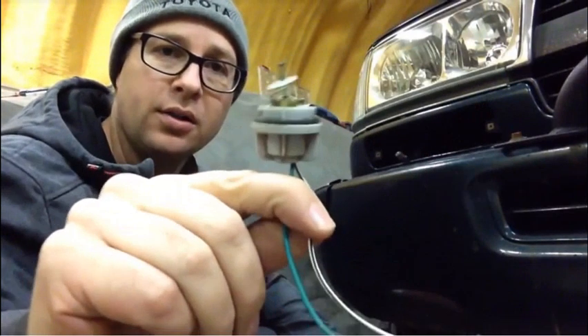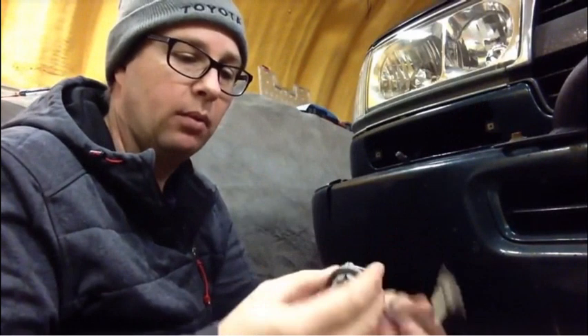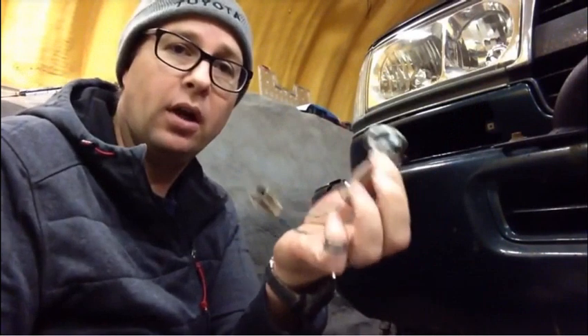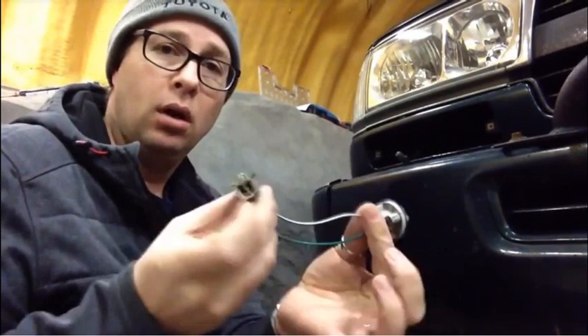So there's a plug there, there's a socket, could be a bad wire, could be a connection — but I know everything up to the front of my truck is working, and I've narrowed it down to this. Very quickly, I know where the problem is. So for the next part, I'm going to use my digital volt meter set on ohms with the tone. I'm looking for continuity — a good path with low resistance — from one end of this wire harness to the other.